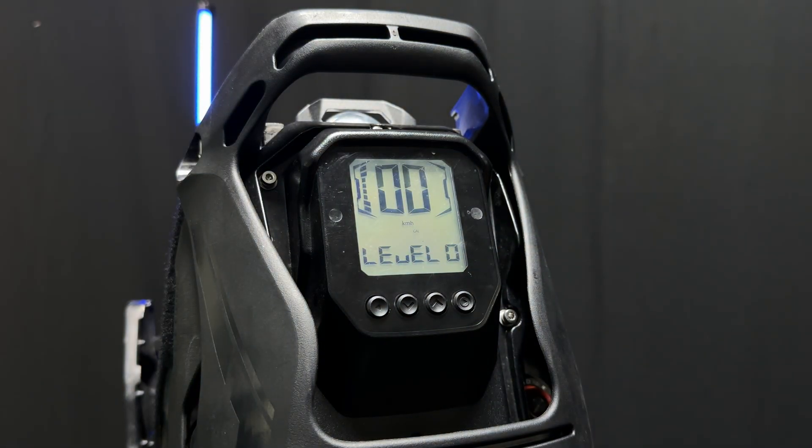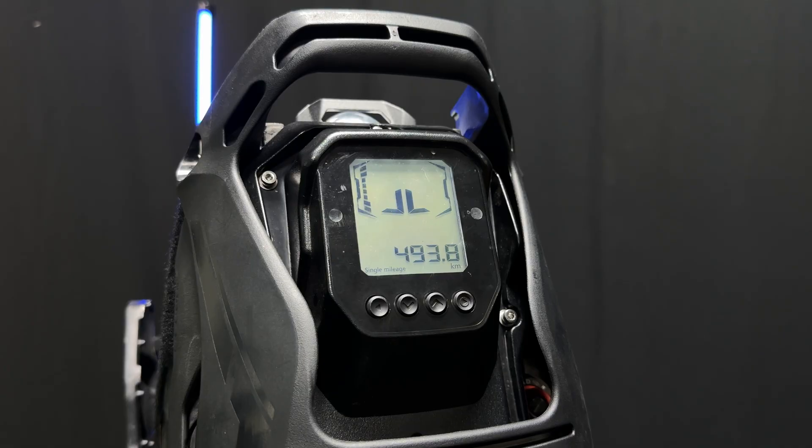CAL stands for calibration. This is where you want to keep the wheel completely level to calibrate and recalibrate your gyroscope. It's good to do this once in a while, but if there's nothing wrong, you really don't need to adjust your gyroscope at all. Mode one starts the process. While you're holding mode one position, mode two confirms the position and mode three completes it. Have a look at the manual — I'll do a short demonstration on how it works.